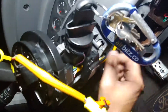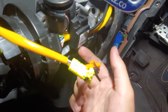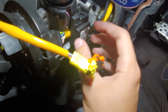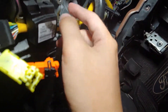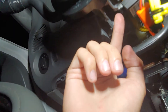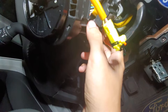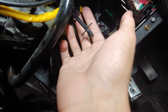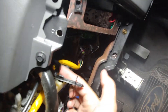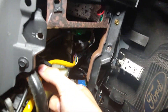The cable routes under this right here, which is the antenna for the chip key — you know, when you copy the key it's not a two dollar copy, you pay about a hundred dollars because you need the transponder chip programmed to your car. This appears to be the antenna, with a black cable going to a green connector. There's a T20 or T25 Torx screw here — undo that Torx and you can bend it just enough to get the cable out and put the new cable in. The new cable came with a plastic locking mechanism to keep it tucked up and attached to the frame. I reused the old one; it has a ratcheting mechanism to tighten down on the cable, so tighten it after mounting to the frame.